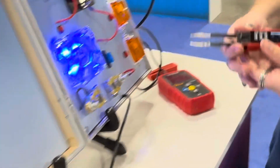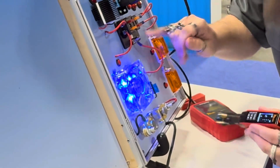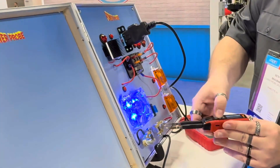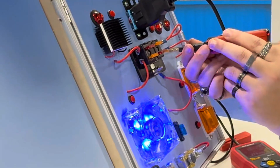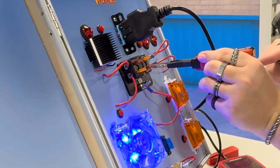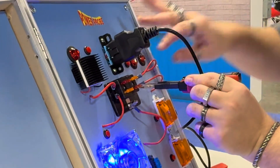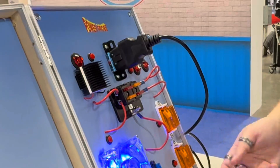So we go further down the line in the fuse box and let's start with this one right here — it's a 10 amp ATC, so we'll bump this down. And we see here that it is inactive, so there isn't a significant amount of current going to it. So we know that this fuse isn't part of what's causing the drain.